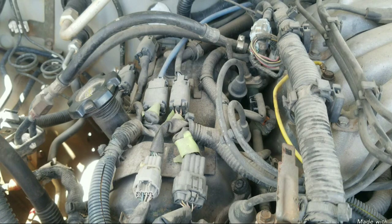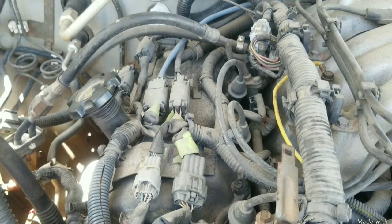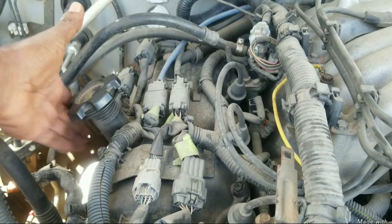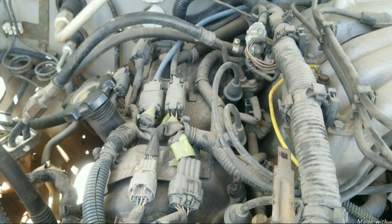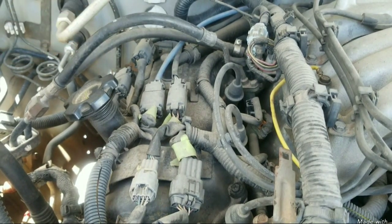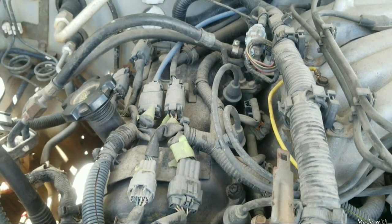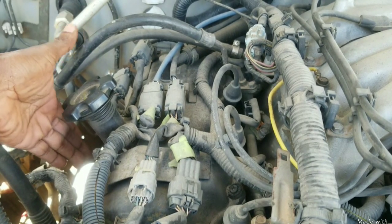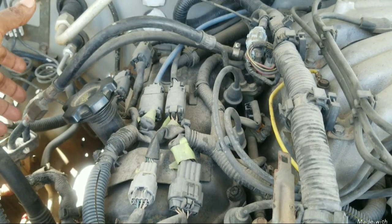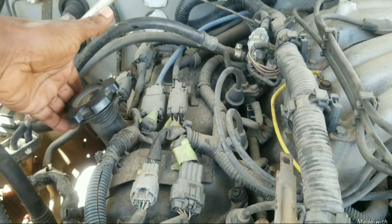Before you do that, I recommend you disconnect this line. It will be very difficult. Also, this is bad engineering — running the fuel line over the exhaust manifold. This is a rubber line, and if you're the kind of person who keeps their vehicle for 20 to 30 years, this line will most likely become punctured or rot and leak. Fuel could leak onto the exhaust manifold while you're driving, which could cause a fire.